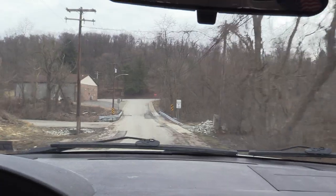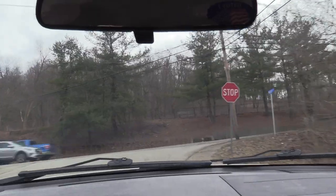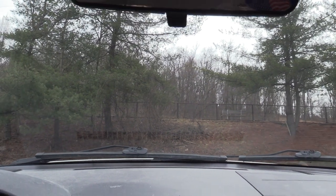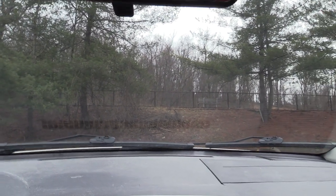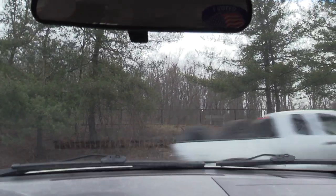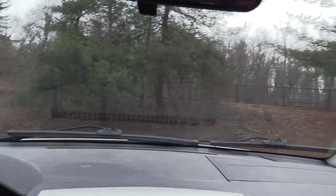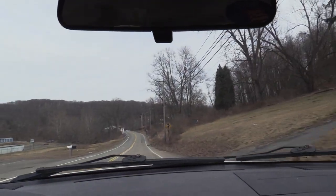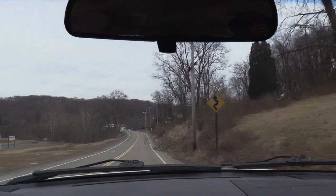Now, I didn't see it dropping out on the scan tool either, but I might be looking at the wrong data point. Vehicle speed on the scan tool may not be the output speed sensor data. I'm just trying to tie in the transmission codes I had with the surge that I'm feeling, because I do not believe it's engine related.